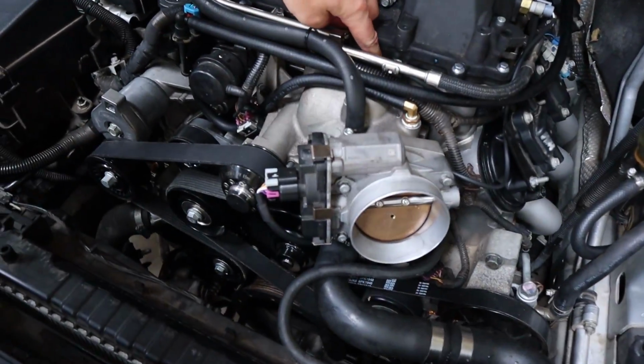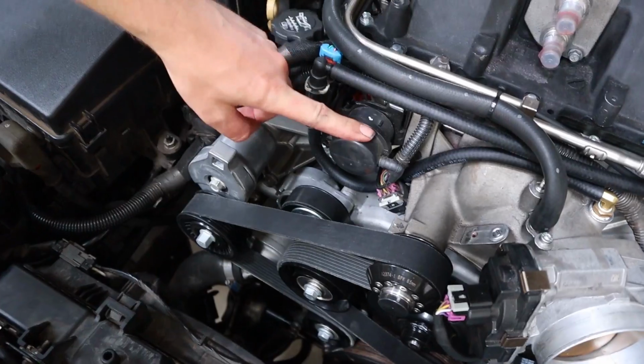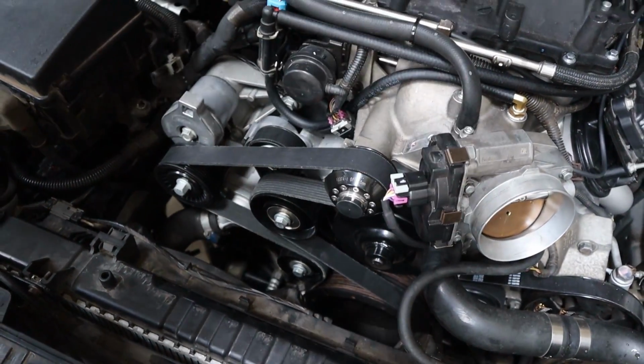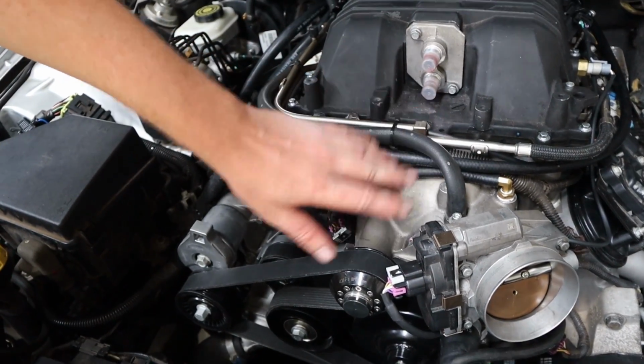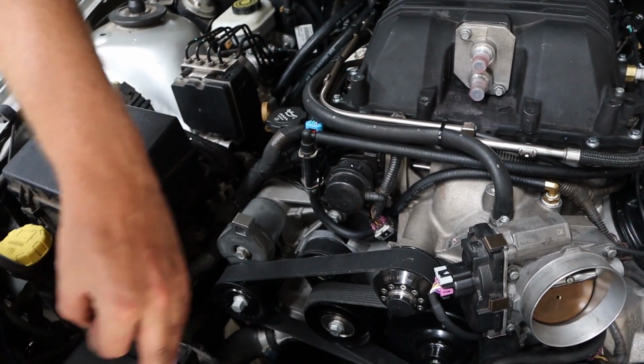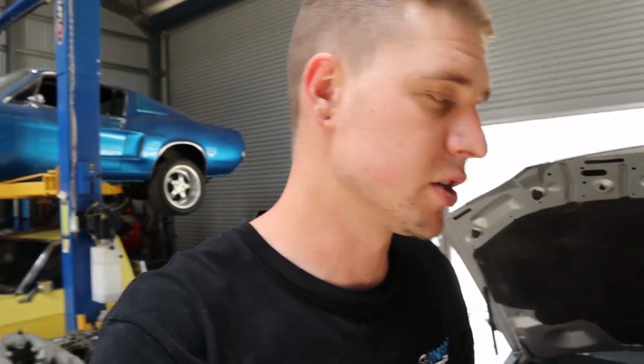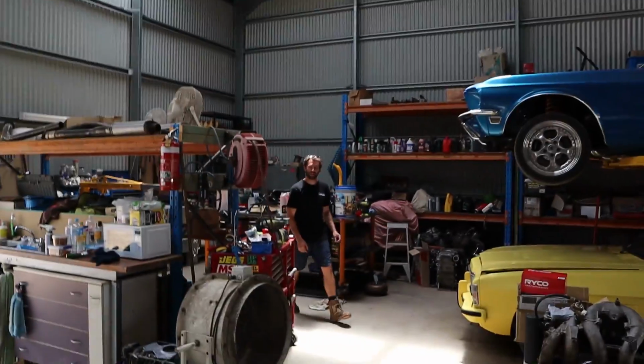Although for those of you who don't know, the LSA actually has a bypass that acts under vacuum. There's a second throttle body around this area, which is actuated by this actuator, which under vacuum opens and bypasses the supercharger straight into the intake. They reckon with this system, the supercharger actually draws screw all. It just makes it way more efficient at cruise and that sort of thing, because it's not actually driving the supercharger. That's a good pun.